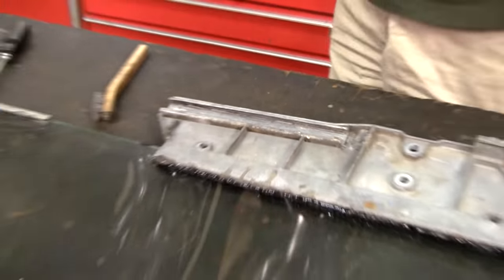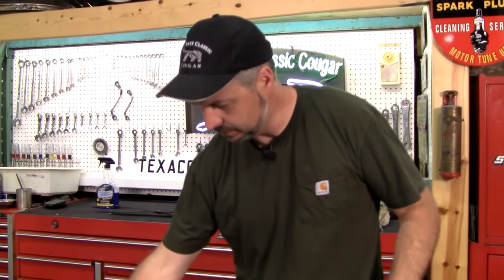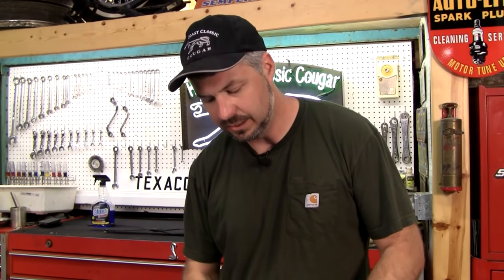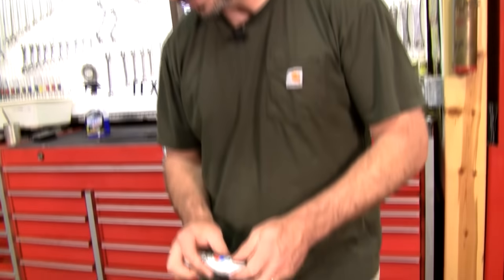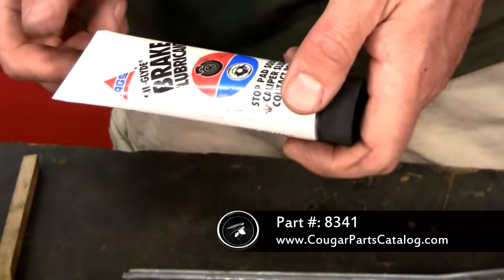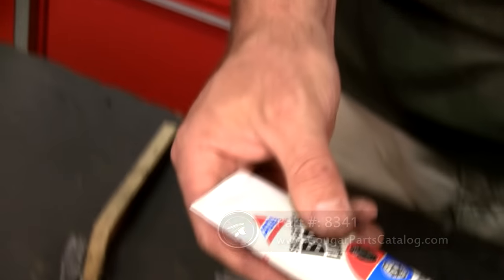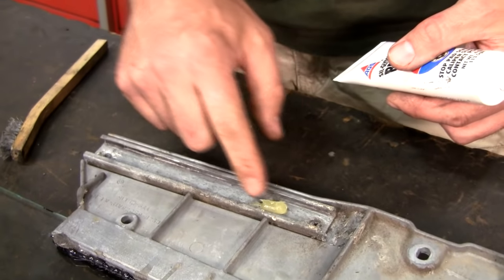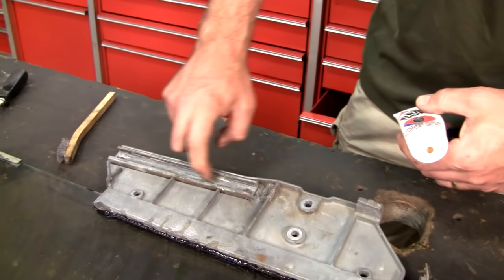Same with the poles, guides that are in the door, every piece that has moving parts, let's get it all clean. And axle grease is not what you want to use here. Most white lithium grease is too runny. You need something that will stay. And this is what we sell on our website. Napa has a version of it that's the same thing, really. And it withstands heat. Comes out kind of thick. So liberal amounts of this heat-resistant lubricant.